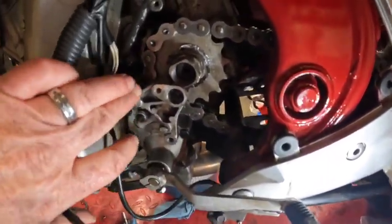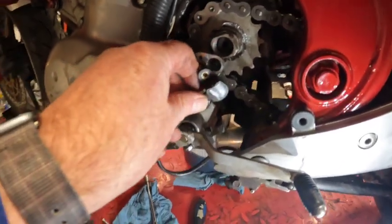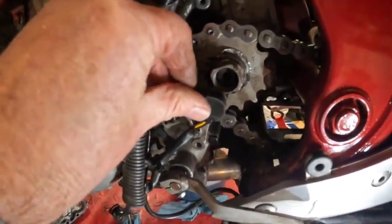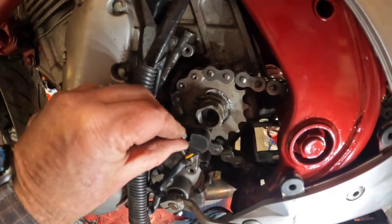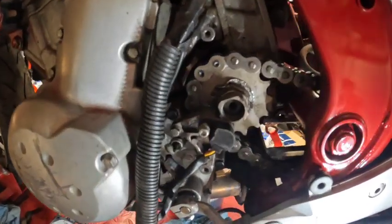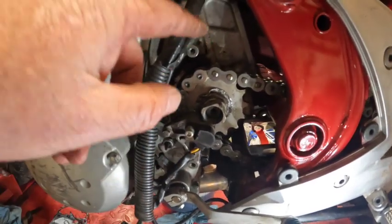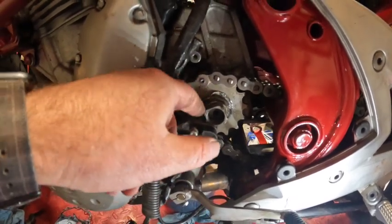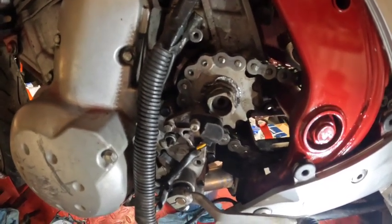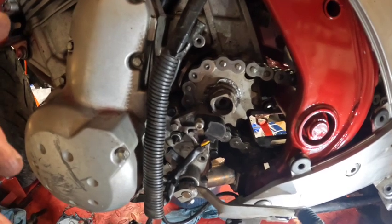We got the bracket back on. I went and got some bolts for the two that were missing. I put the speedo bracket back on, so now we can put the speedo sensor back in and get that little screw in there. I put this screw in and that brings the speedo sensor so much closer to the piece it needs to read — it's no surprise it wasn't picking it up before. I got the piece torqued down. We'll have to adjust the chain when we get it off the lift, but the speedo should work fine.